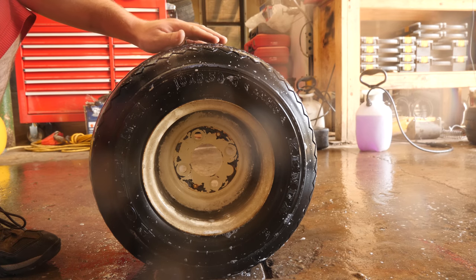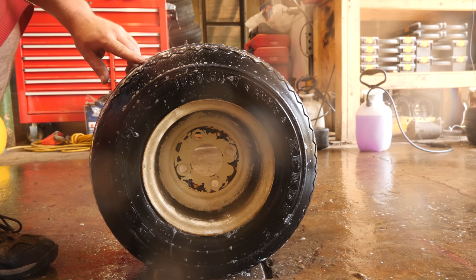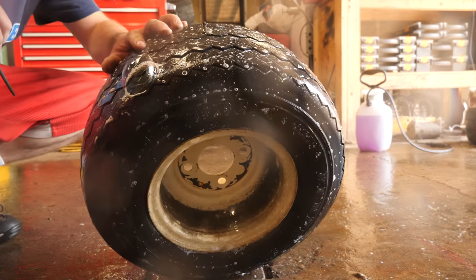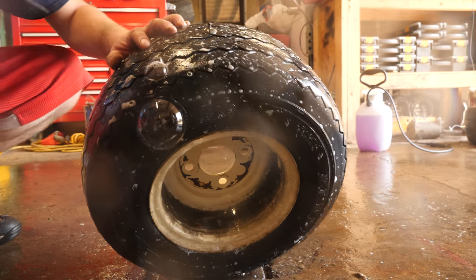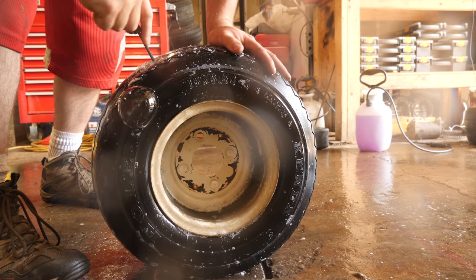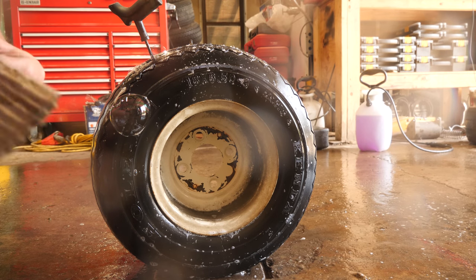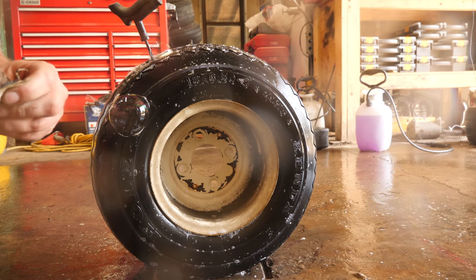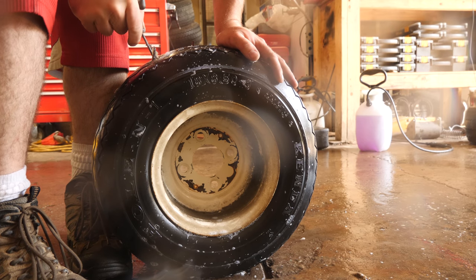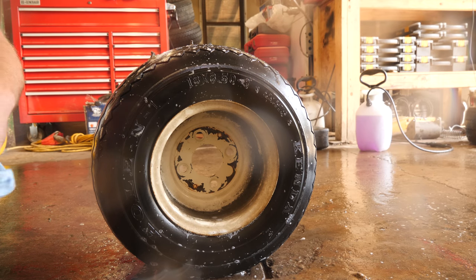Do I feel air? I think we have another one. Okay, we have another hole right here — oh, this is a multiple hole situation. We'll do the same thing on this one; you can see how that bubble is blowing right up. This one has multiple punctures, and I like to try to plug them first. Let me get some air in this tire. Then we'll push it in and release — okay, that's two plugs.